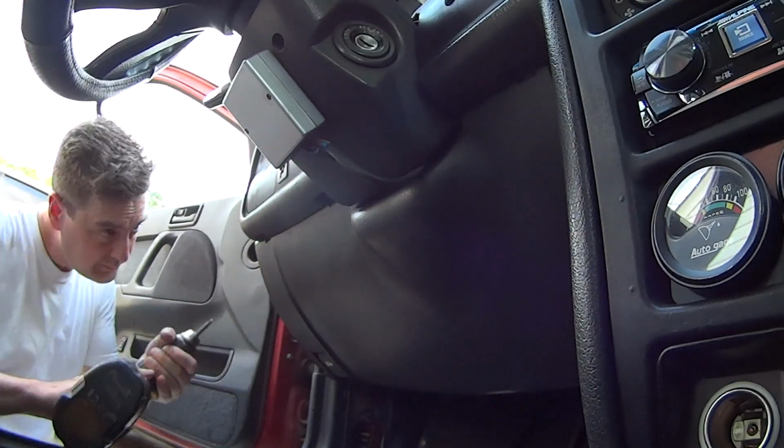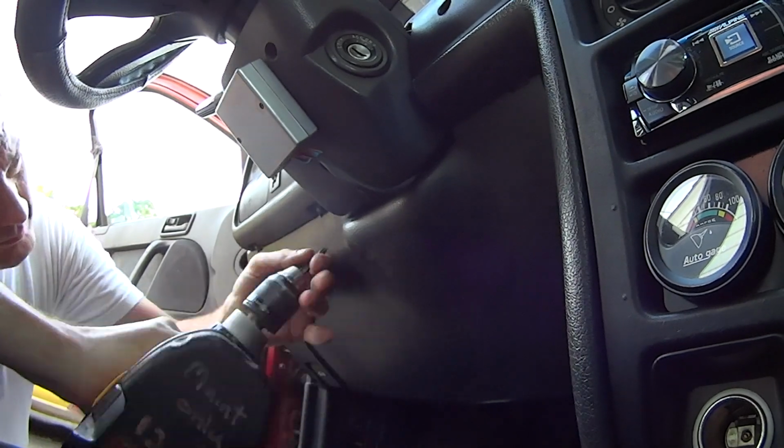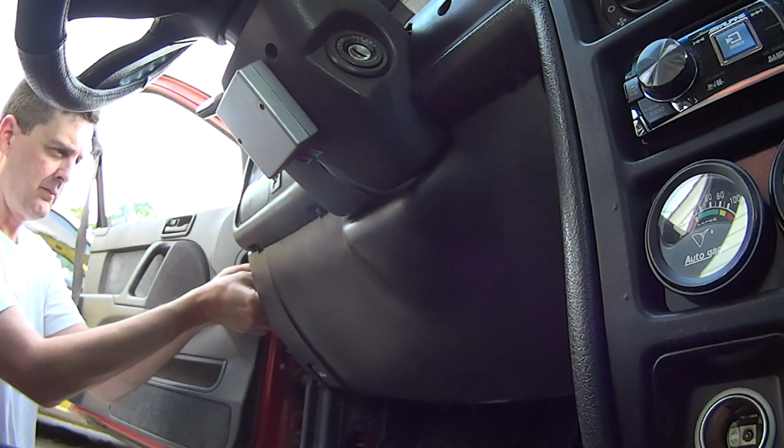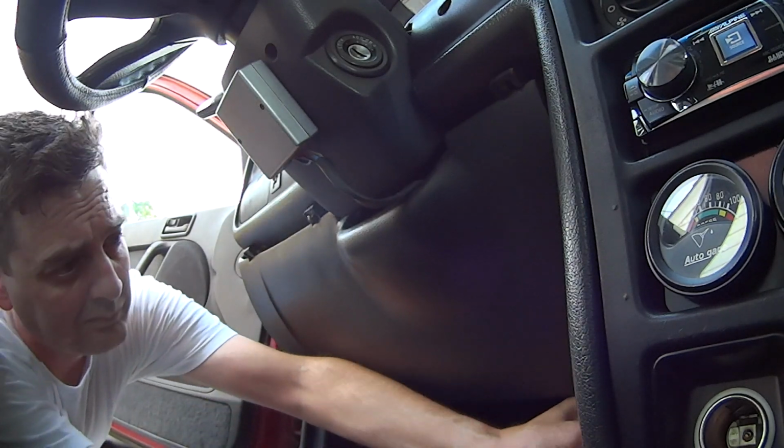Fixing this at home will save a ton of time and trouble, and it should be a fairly easy fix. So the following day, I lifted the front end, checked all my fluids, drained the oil, and took a stab at fixing this clutch switch. I disconnected the battery, and I unplugged the harness from the ECU so I could weld on the chassis without frying anything. I'll need all this stuff to work once I get to Ohio.